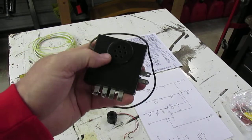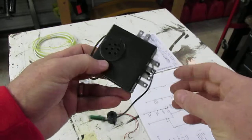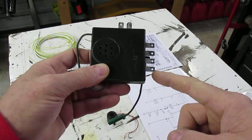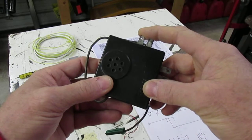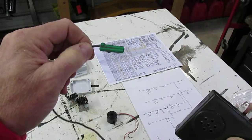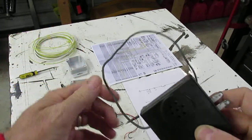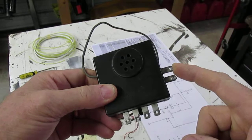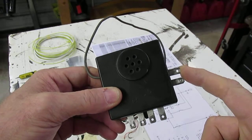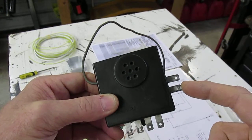It's a pretty strange bird. I have a schematic to the car, but you really can't tell much about it — it's old 1970s stuff. Basically these four connectors here plug into the convenience center near the fuse block, and then there's two wires that come out of the harness that plug into here. This wire here goes back into the convenience center to the lamp's outlet, so when the headlights are on you get a 12-volt input. One connection comes from the hazard fuse, which is hot all the time — battery power at all times — and the other one goes to the key switch, where if your key is in the ignition it grounds that connection.